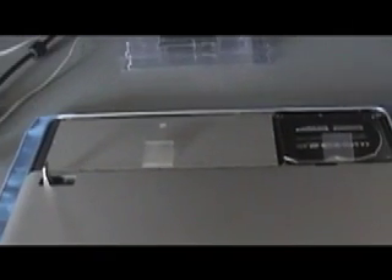I'll go ahead and set the battery cover aside for now. Here you can see the battery and the hard drive. We'll go ahead and keep the latch flipped up to get the battery out. I almost learned that the hard way because I thought I had to pry the battery out, but I realized I had to turn the latch up to get it out. It just comes out with a nice little tab there.